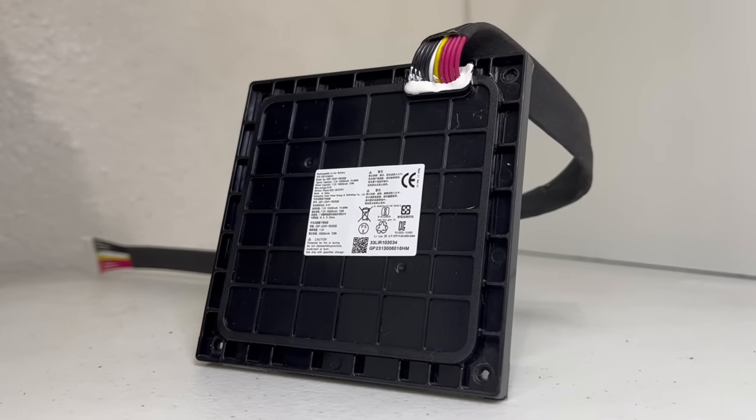With the battery removed, we can continue to remove four screws from the side of the speaker and then repeat the same thing on the other side. We will return to the top of the speaker to remove two screws that are holding down the heat sink. This heat sink acts as a mount for the two boards as well as helping cool the boards from the heat that they generate. Next, we will remove the retractable handlebar by removing five screws. After removing the screws, you can either pry it off, but I find it easier just to hit it outward a few times. Here we have the handlebar — it has a nice comfortable grip along with the PartyBox 310 name printed on the side, and spring locks that easily lock the handlebar in place when not in use.